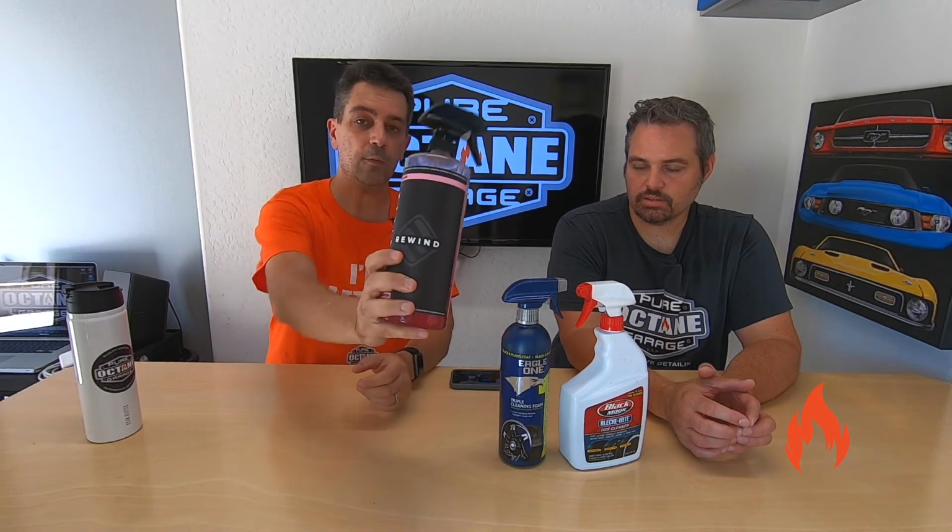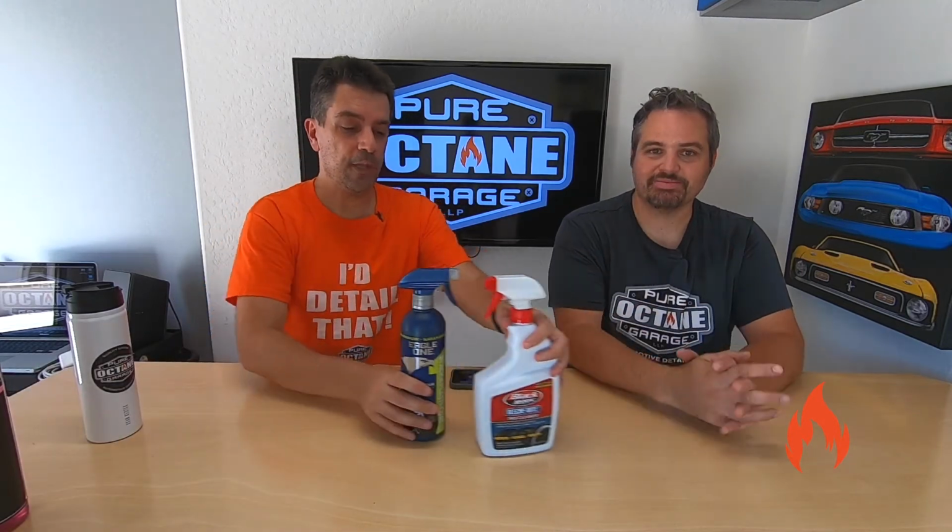And then of course for your vehicle that you want to take care of and protect, I would use a good strip wash that won't dry out any of the trim or rubber seals. It'll remove old product, and then a good dry, and then a wipe down with a product like Rewind. Another way to remove coatings is machine polishing your vehicle, which will remove it too. You still want to use something like this afterwards to clean off any polishing agents left behind. But that'll take off a coating for you. I almost forgot to mention that. We're not going to do that, though. We're just going to show the basic thing that we do, stripping the test panel.